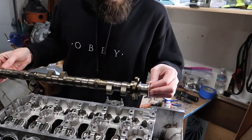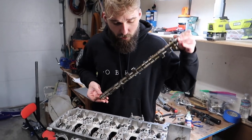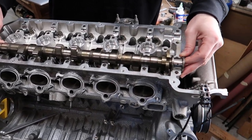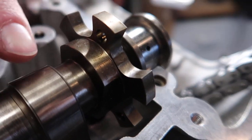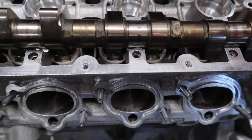When you put these cams on, in this case, this is bank 2, I think, right? So these are pistons 6 through 10. Make sure that the lettering, as you can see, the little engraving, is facing upward, and that lobe right next to it is facing more down that way, right? That way, it's gonna be much easier to put these in time.